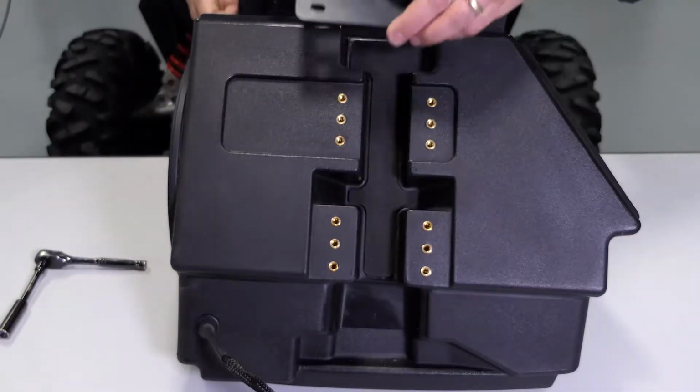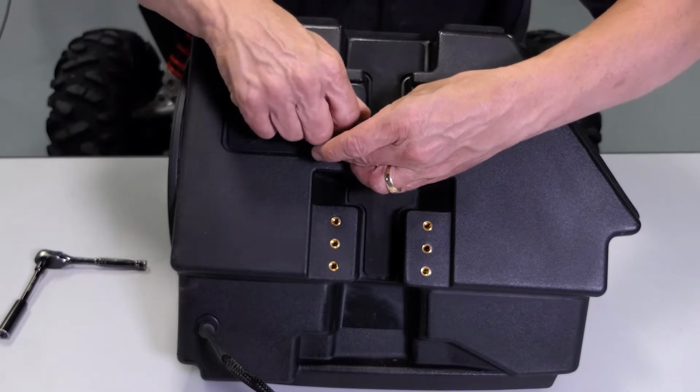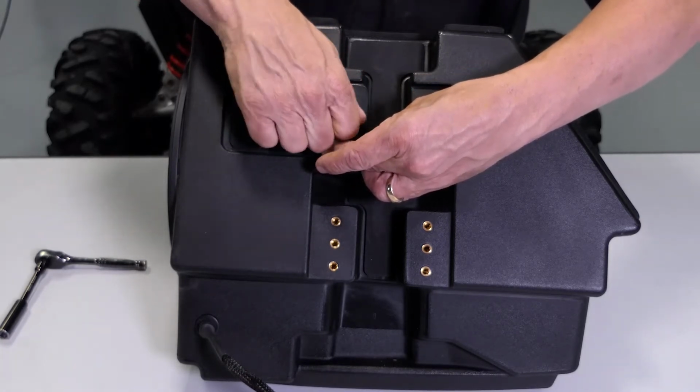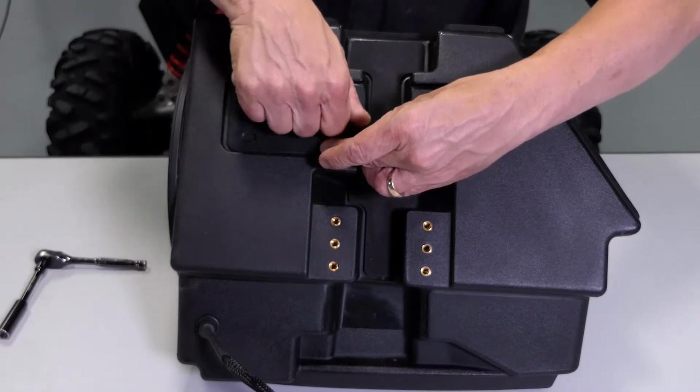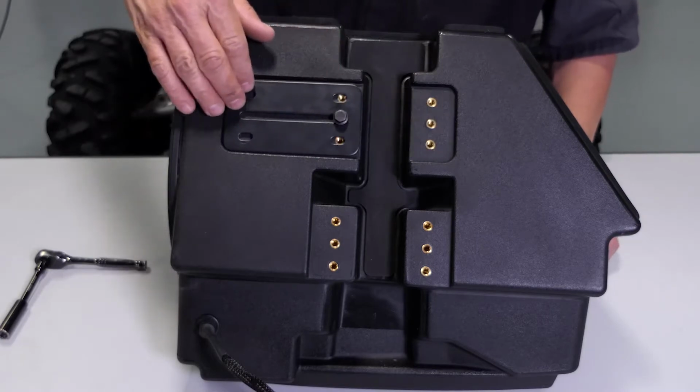When prepping the subwoofer enclosure for installation, use the larger of the two brackets supplied. Insert the bracket into the recess on the top of the subwoofer enclosure. Using a 10mm bolt, insert it into the slot on the subwoofer side of the enclosure, hand tighten, allowing the bracket to still slide.